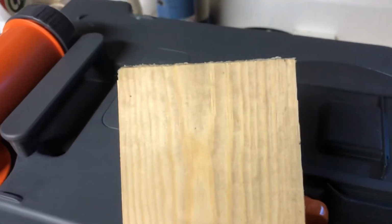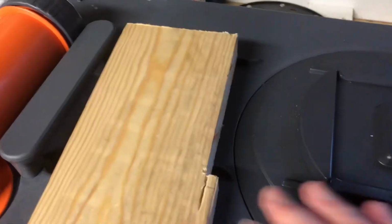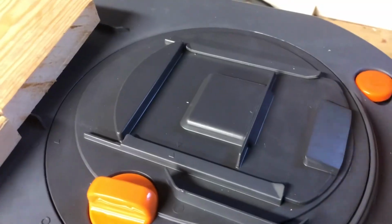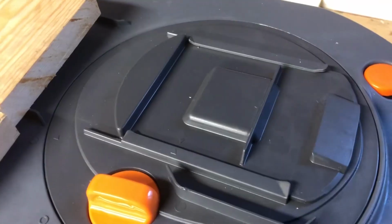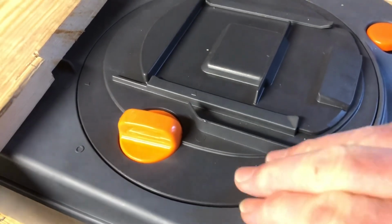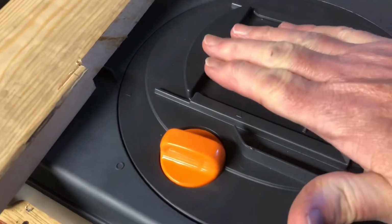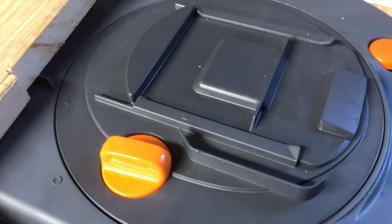Now this is 87mm across from here to here. Now that's a snug fit between that rail and that rail, and you will need to tap it through to get it into position. Then you can use it to twist it to open the cassette, and I found it invaluable to close it because the seal's new and it needs to be pressed down to engage the lugs for them to slide under. Using the piece of wood allowed me to put downward pressure and twist at the same time, and it was very, very easy. So there we are.